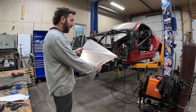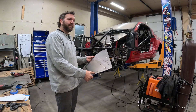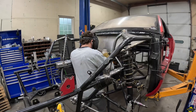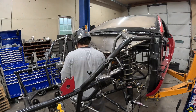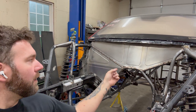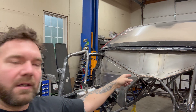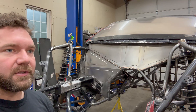We have our next piece of the firewall. Sheet metal is my least favorite part — I don't feel like I'm that great at it, always learning, get frustrated easily. But let's get this cleaned up and tacked in. We're using the silicon bronze here again — sheet metal to tube, just take your time, you don't want to burn through it. I put some bars in here. I waited to get this piece in before I did that — I wanted to see where it was going to land before I put the bars in. It was tough to put in, but we got them.